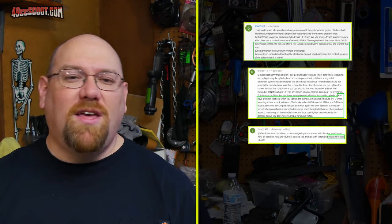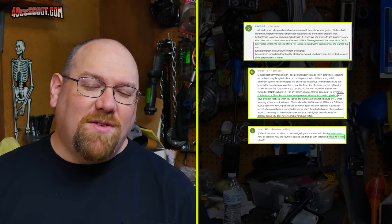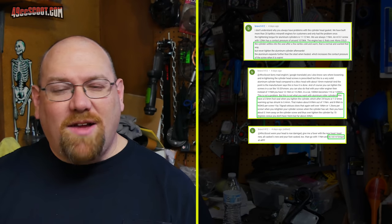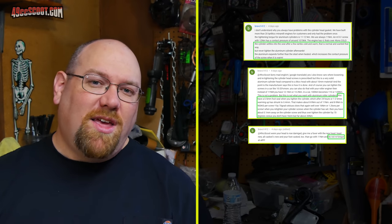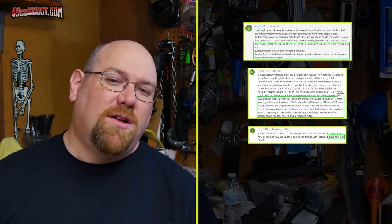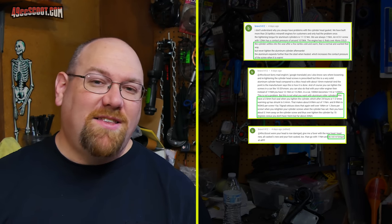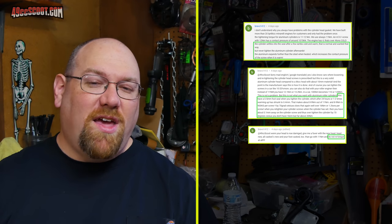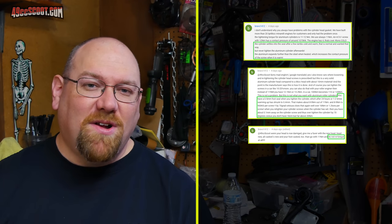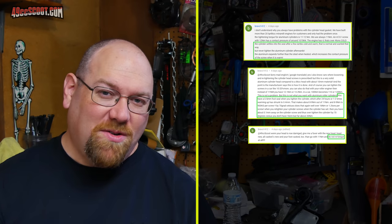What he's saying is that by doing this, I'm causing way too much clamping force on everything, because the cylinder, the head, everything expands when it's heated and then contracts when it cools. Everything distorts, etc. And he's saying that the manufacturer doesn't list a spec because they intend for it to be this way. They're accounting for any base gasket compression or any gasket compression when they give you the initial torque spec. They don't want it retorqued.